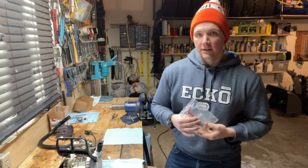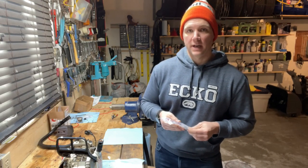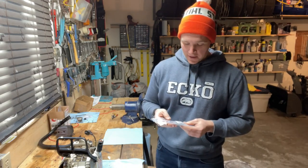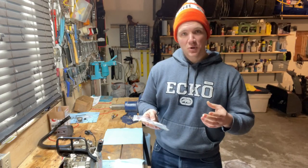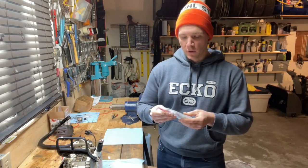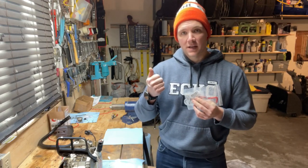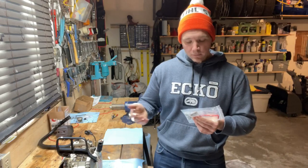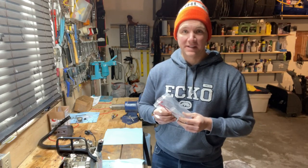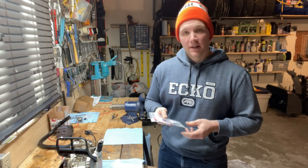I'm going to show you how to fix that. I bought a helicoil kit from a company here in Canada called sawparts.ca. There are a bunch of different places you can buy these — I'm not sponsored by them, I'm just telling you where I got my stuff. It's essentially a way to insert a new set of threads into the engine case. You need to find the right size of the original bolt and the thread pitch you want to put in. A little bit of drilling, a little bit of tapping, insert the new threads and you're off to the races. Let's do it together — I'll walk you through it.